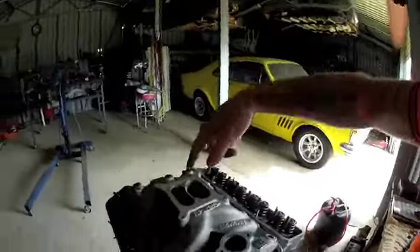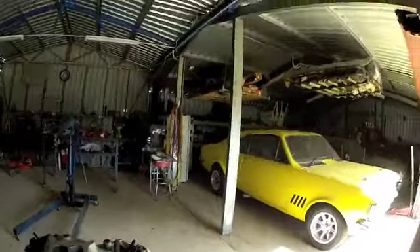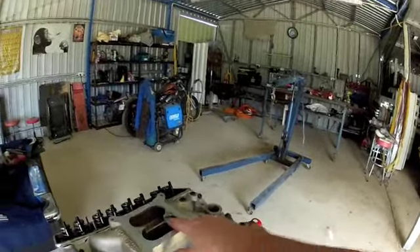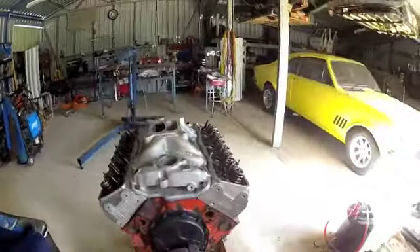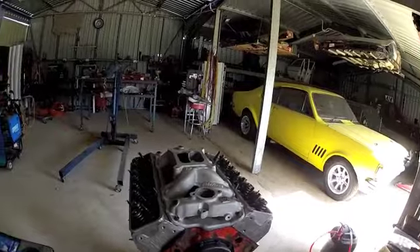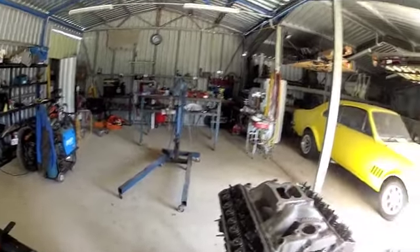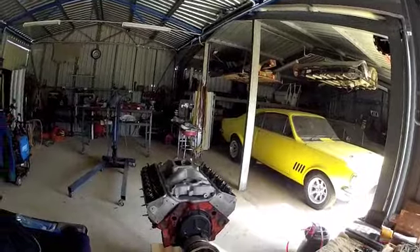That's pulled down. I basically do it the same - start on the inside and work around. I don't know if you remember when I put the intake manifold on that old girl I was talking about this step notch. We'll see how on the newer ones they do it factory. I watched a video with David Freiburger, the old editor of Hot Rod, doing a dyno comparison of when it's fully sealed versus having this notch. And that notch made - not significantly more but a noticeable amount more power and more torque through the whole rev range.